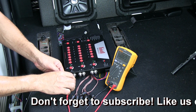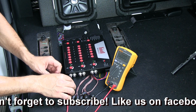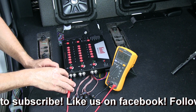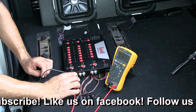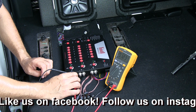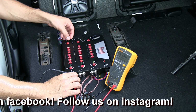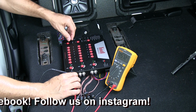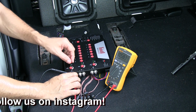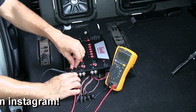You can see the voltage changing here. All right, so here we've got 0.12413 volts coming out of the ReCurve right now, and we want to get this to about 1 volt. So we're going to take the front and we turn this knob to say about 3 o'clock on a watch. Then you take the output knob and you turn that up slowly until you get to 1 volt.